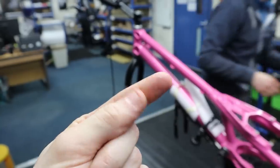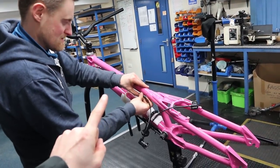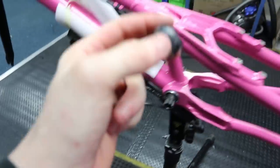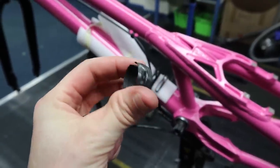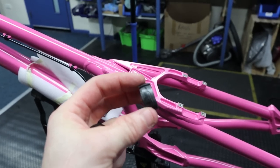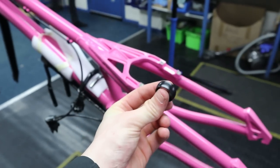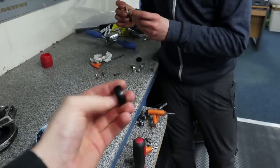One thing I'm going to spend some money on — slave cylinder washers. This is what goes around the cylinder and what the clamps actually clamp onto, so you're not damaging your brake. The old one has some pretty big gouges and marks, which makes setting up the brake tricky — it'll want to find those grooves rather than where you want it. A nice new shiny one gives you full freedom to position the brake exactly where you want and set it up a lot easier. They're only a couple of quid and make life a lot easier.